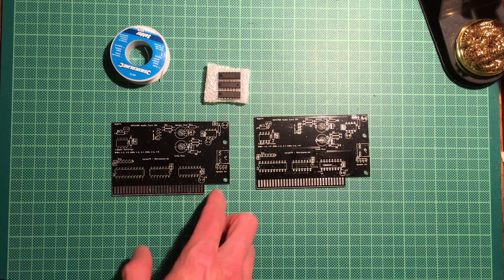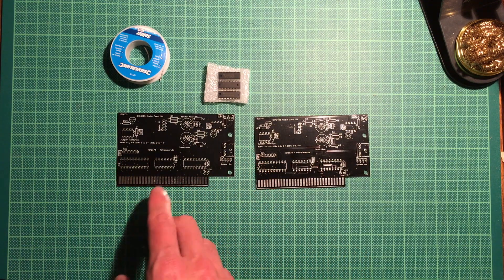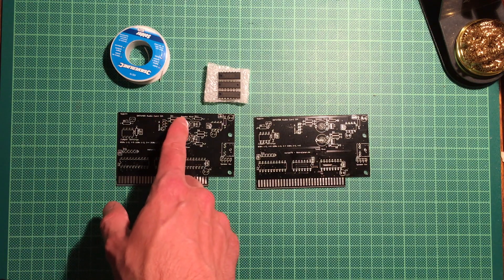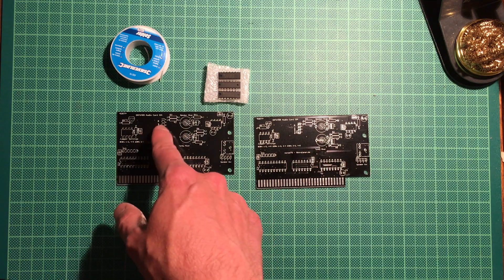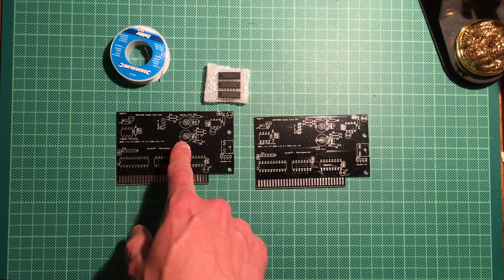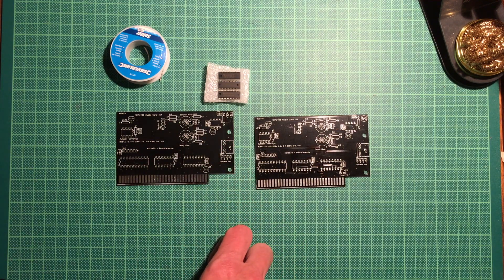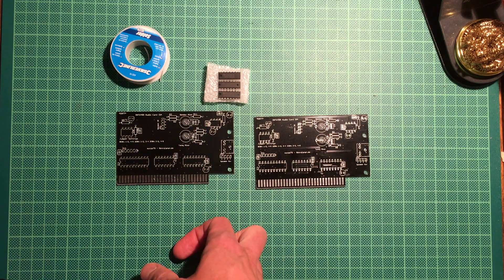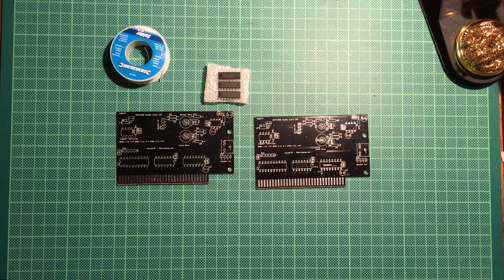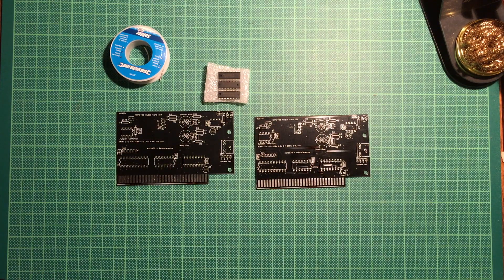I'm not sure how many games I'll find that work with this, but I think it's a nice little retro sound card. It's very compact, and a very nice feature is that it has a PC speaker input and two adjustable potentiometers to mix both the Tandy sound with the PC speaker sound, which you can then send out of the audio jack. That's really useful because there are a lot of games which only support PC speaker, and usually those cheap speakers are pretty loud and you can't tune the volume.